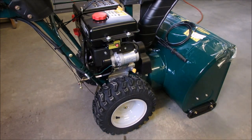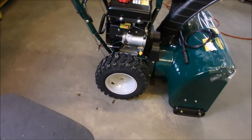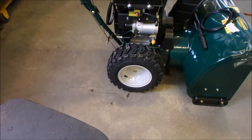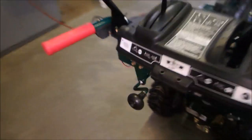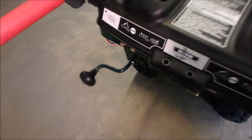So just to recap, to do this job really all you need is a pair of pliers for the cotter pins and a compressor to put some air in the tires at 14 pounds. I put a very small amount of oil in it to get it up to the full mark, and I did a little bit of lithium greasing here and at a few other rotation points. So that's about it guys — that was kind of fun. Now we're just going to fire it up.